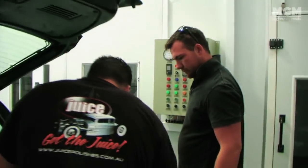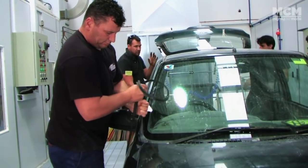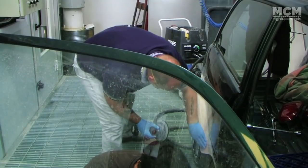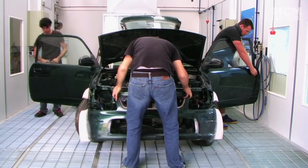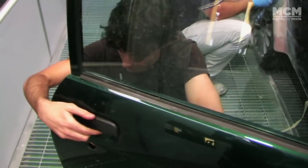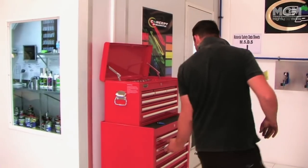With any paint job, the first step is to strip the car back as much as possible. We wouldn't be painting the inside, so that makes things a little easier. Paul got to work further shaping our body kit while we stripped off everything we could. The bumpers, door handles, door locks, and even the rear windows get removed.